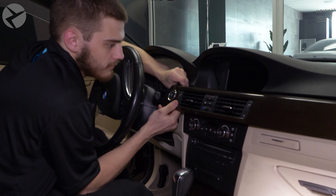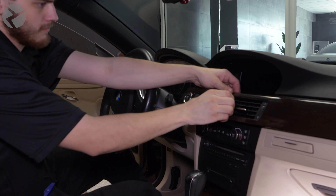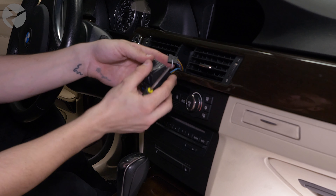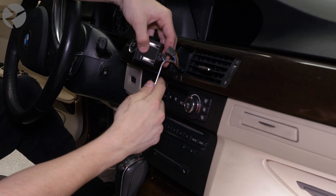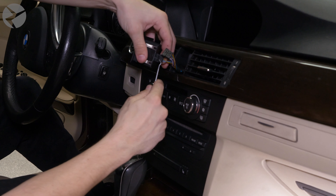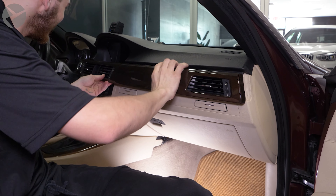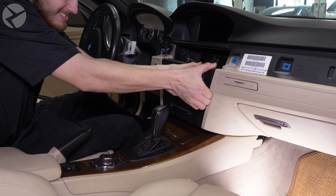Let's get back into the car. Secure the cable onto this harness and then down under the panel. Don't forget this clip that will go back into the bolster trim you took out. Continue feeding the cable under the panel and behind the carpet.